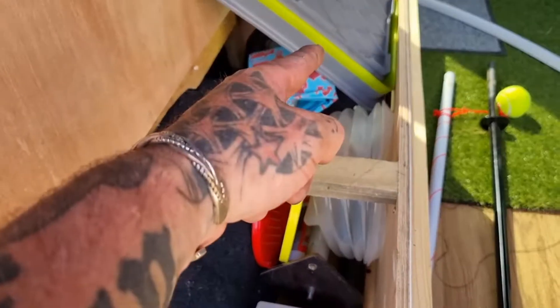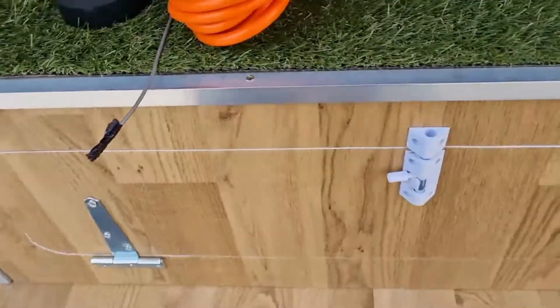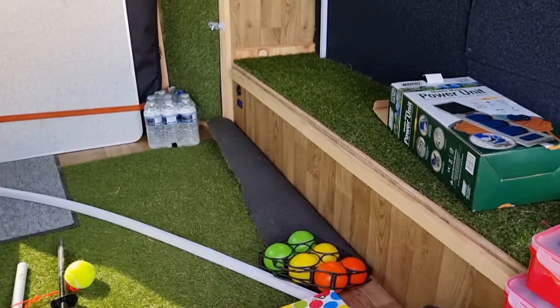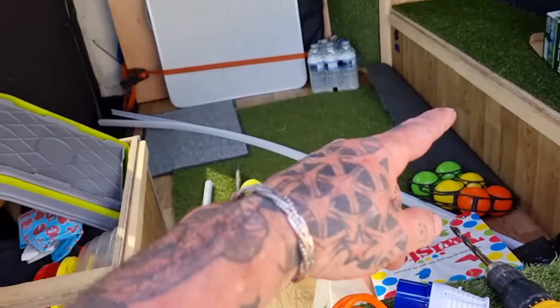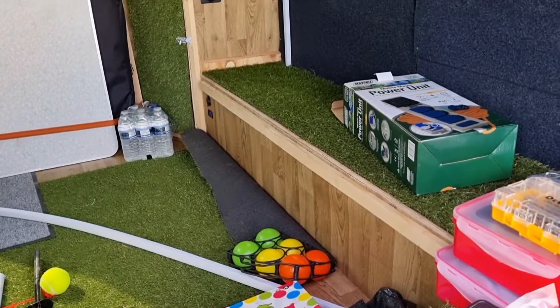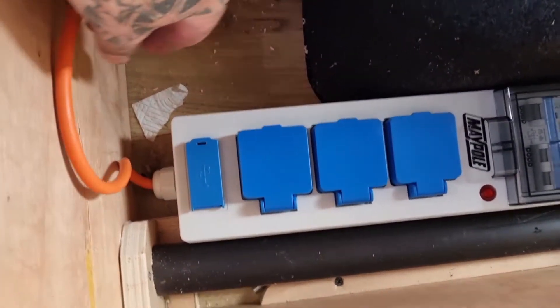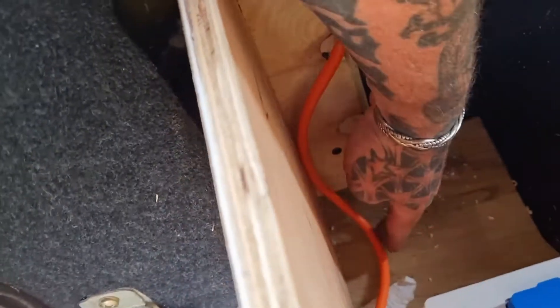I'm going to run a single to the side socket, then come through, down under, and down by my voltage meter. I'll have a double socket there - so if I pull up at site and they've got electric, I can have a socket outside. I can also plug a charger into the mains into the leisure battery if I need to. So I'll get that drilled and fish the wire through. That's where the box is going to live - it's fairly held in there, pinch tight.